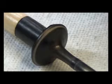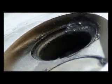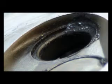After doing this for about a minute, you should see a ring around the valve where it contacts the seat. Be sure to clean both the valve and the valve seats thoroughly.